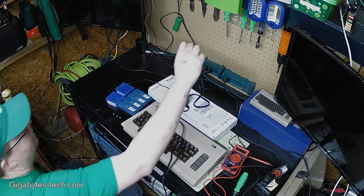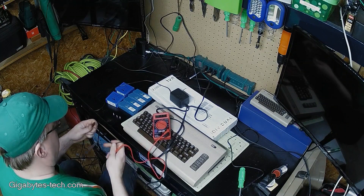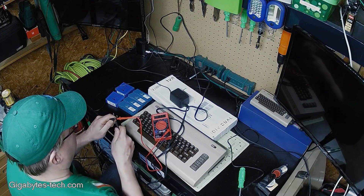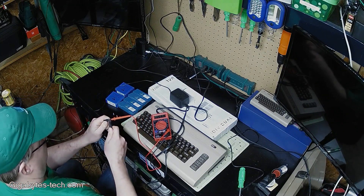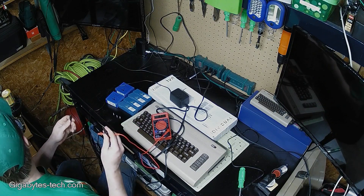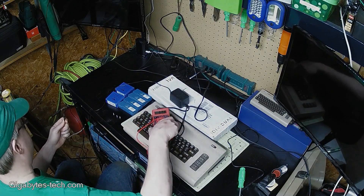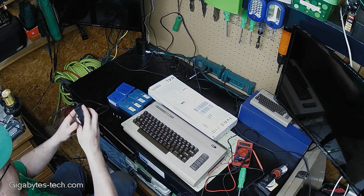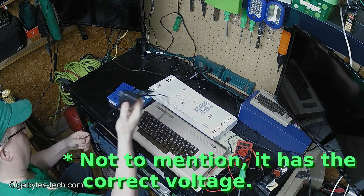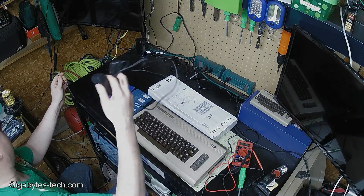However, there's a problem. So we're going to take our multimeter here, plug that into the end — positive lead goes here, negative lead goes here. I'm getting a voltage reading of 15.5 volts. I double-checked it with a couple of others, and they read the same thing. We're getting 15 volts off this power supply, which means this power supply is no good. This one isn't as nifty, but it'll get the job done. It is also a 12-volt, one amp power supply, but it's got an exceptionally long cord, and that's kind of a good compromise for me.